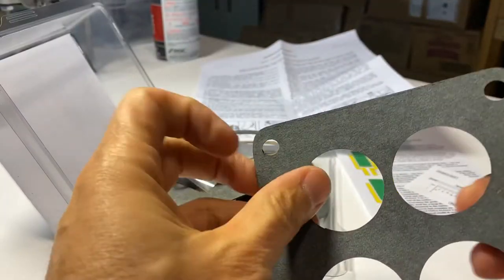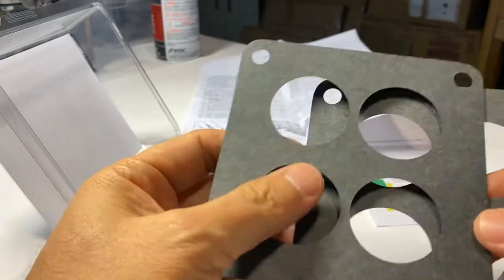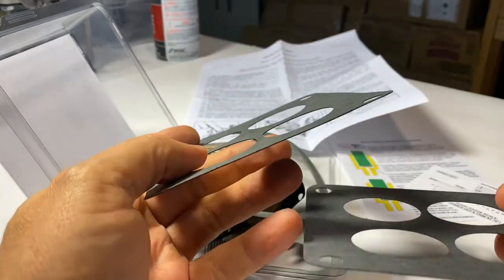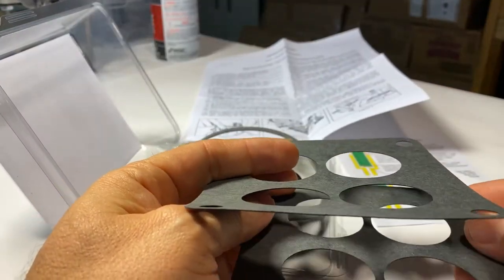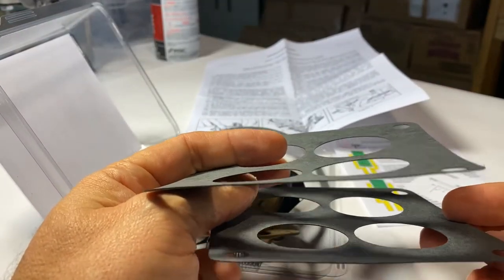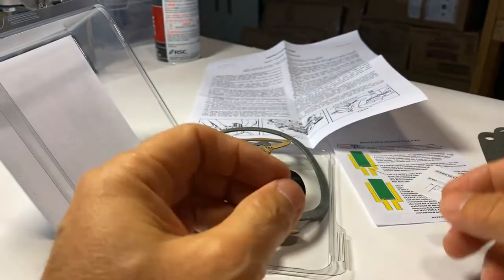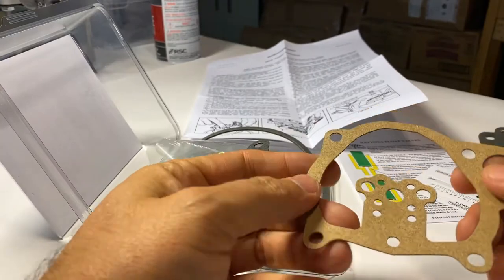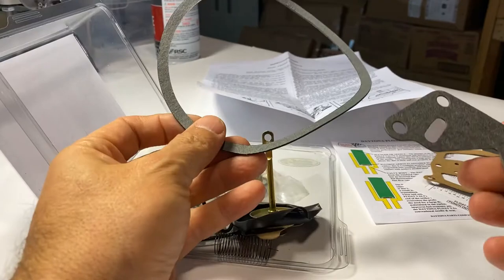These kits come with two gaskets. Some of the other kits don't come with two. The reason they would come with two gaskets is because most of these teapots — if not all the ones I've seen — have always had some kind of a phenolic spacer between the carburetor and the intake manifold, certainly to help with diffusing the heat. Of course we have our float bowl gasket — this is for one that would have a governor on it as well.